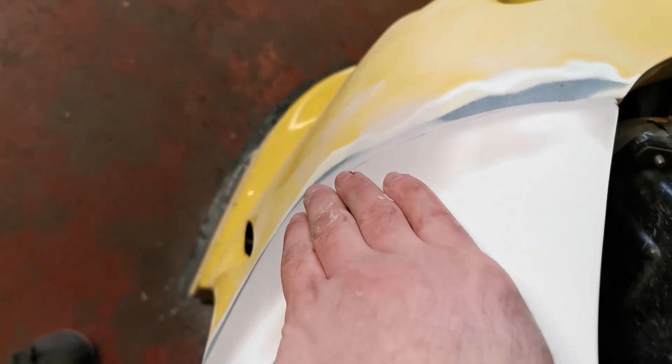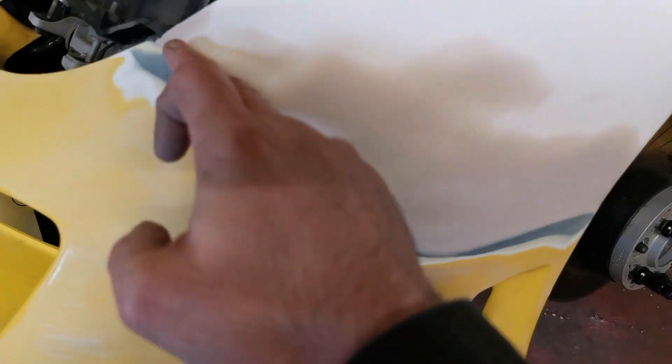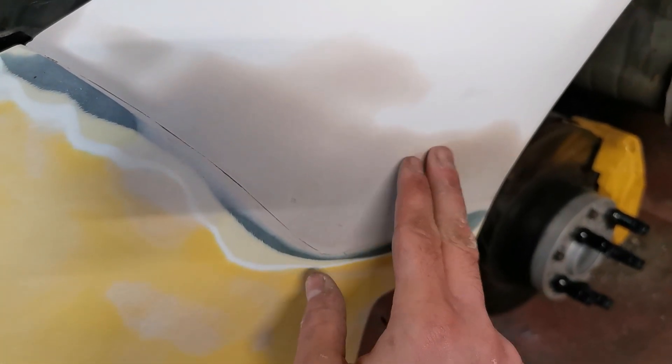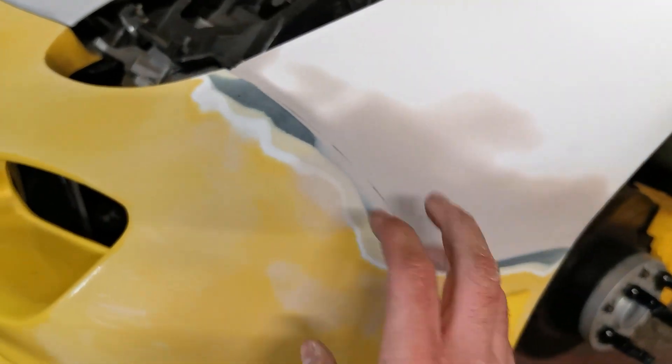Let's add a flush of body filler now. We've cut with a Stanley knife down there — obviously that's rough, we'll tidy that up when we take the bumper off. I've sanded it down and now that is perfectly flush. Probably need a little bit more here, I can just feel it. What we'll do now is take the bumper off and work on this edge. We've got the height of the bumper and the height of the wing set so we can take them apart and add a bit more filler — it feels higher here than here, like a bit of a dip. We'll add a bit more to make it nice and flat, block sand it, and then it should look pretty decent.